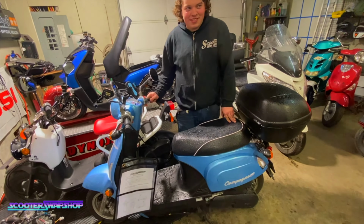Clear bowls are pretty cool just for tuning. They do serve a purpose. If you get one for a CP, be prepared, they will warp and leak. They're not made to be used on a regular basis. They're just made for tuning, but they're pretty cool for getting a setup. Let's see if that's good. You don't really know until you just take it and ride it.